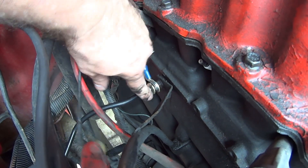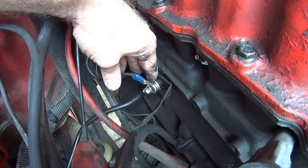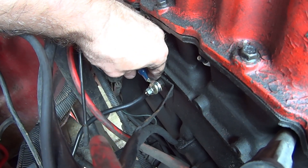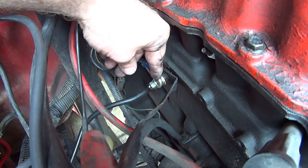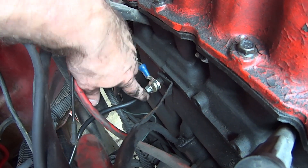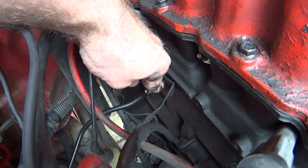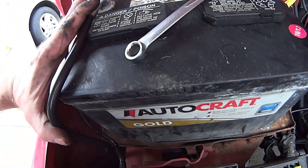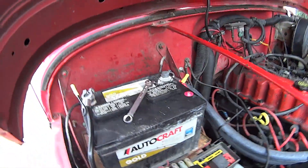I have the cable in place and the nut sort of started. I added a couple additions - here's a 5/16-inch washer, and here's another 5/16-inch washer. What that's going to do is compress all the grounding area together to make sure you've got a good solid ground, because otherwise it was just that flat area of the nut squeezing on a small contact surface. Make sure that's good and tight, but again it's a small stud, so don't get crazy cranking it down. I ran it under the battery tray and it came up here, which is going to work for that purpose.